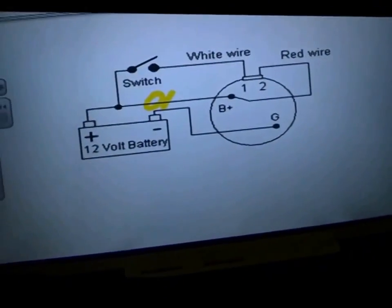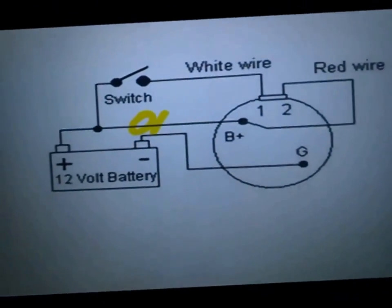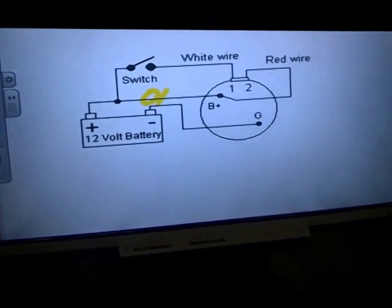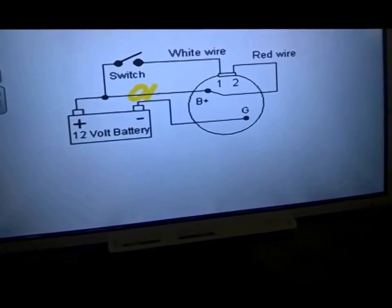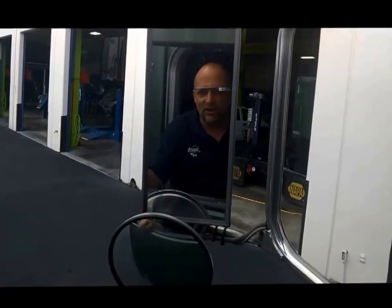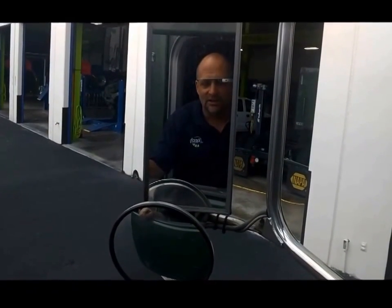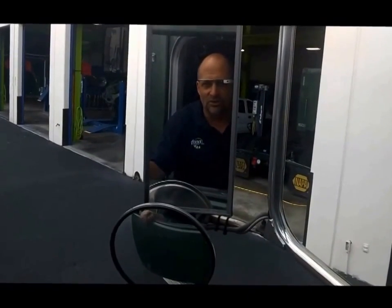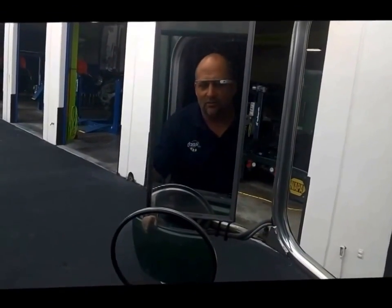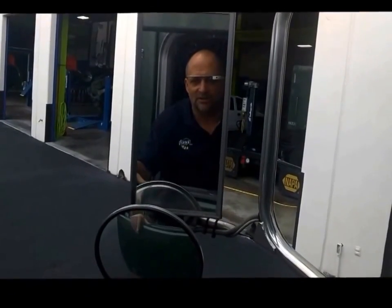We found that we had no battery voltage at the output side of the alternator — pretty simple fix. As you can see, understanding basic electrical, no matter what it is — forklift, generator — it's just a basic understanding of how to use test equipment to follow a diagram. So let's move on to the next: a 2009 Peterbilt. The batteries go dead after about 24 hours of the truck sitting. First thing we're going to do is a visual inspection, make sure nothing's been left on — interior lights, these types of things.